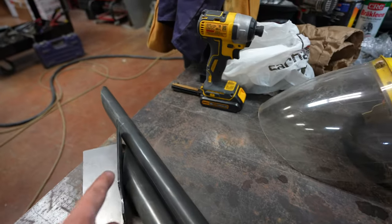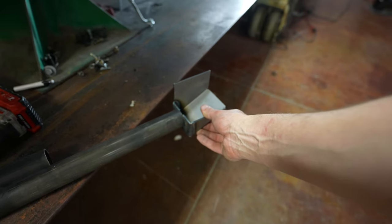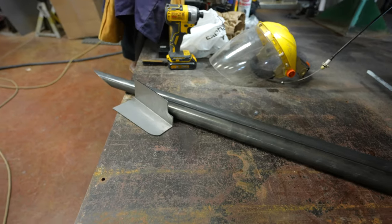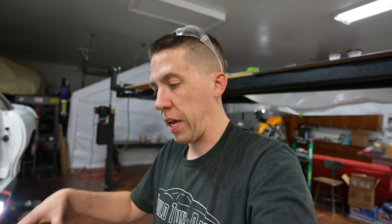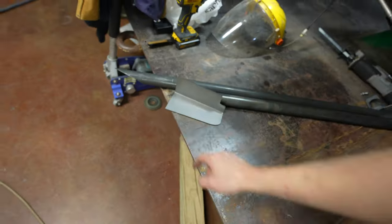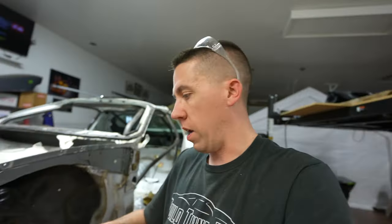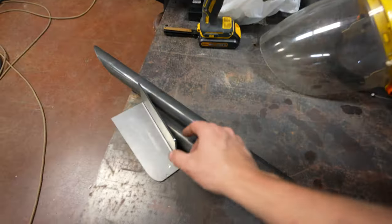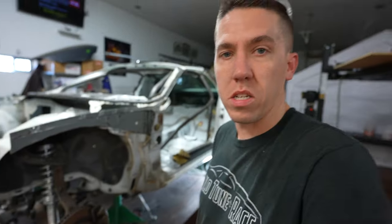My plan is to tack this all in the car here, let this flow on there, and then once all of this looks good and in place I'll cut the tacks off, drop it back out, and weld it all back together. Then it goes up and all I have to do is finish welding all the way around the edges to tie it to the chassis, so I can do nice TIG welds right around the tubes. If you were to tack it in there and try to weld up across the top under the car, that would be almost impossible — you have to be able to look down at that weld. That's the plan for this video, so let's get installing.